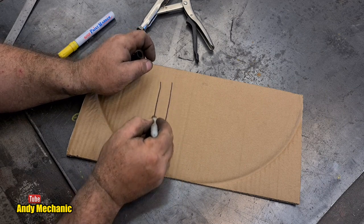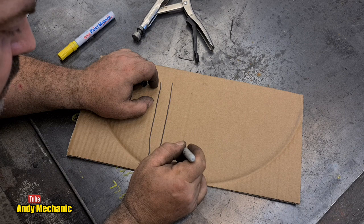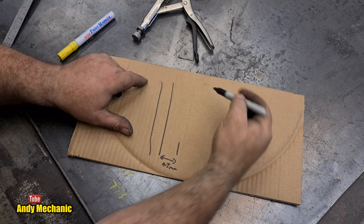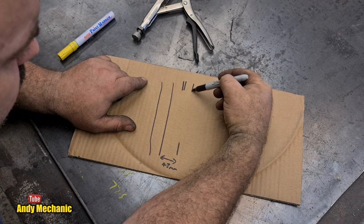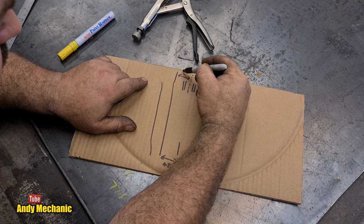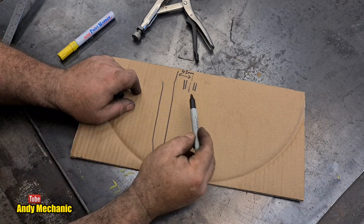Okay, so we've got the extender hitch down here, that's the box section, and about here I'm going to draw it not to scale just to give us a bit more room for drawing. We've got the arm off the handbrake and that distance there is 43 millimetres, and over here we've got the two cables coming in down there, and the center point between those two cables must be, or should be, ideally 43 millimetres. The reason for that is that the centre of the balance bar will be in line with the pull. We don't want it all to be pulling off to one side.